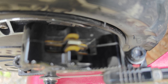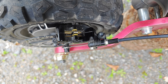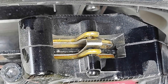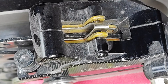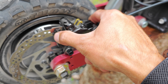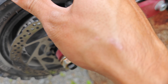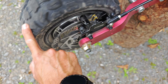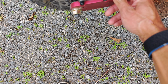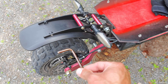If you can look just in between — sorry about the focus guys — if I can zoom in, see how the left is kind of closer than the right. So I'm just going to space it out a bit. There we go, back to normal. We have some rubbing, so I'm going to go ahead and just adjust that. Very simple. Go ahead and just make sure these are good and they can move around. Go ahead and just have your Allen key on standby.